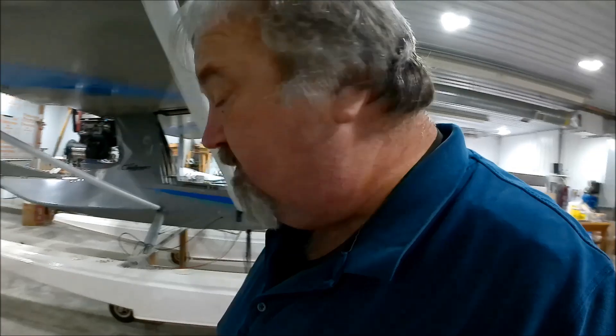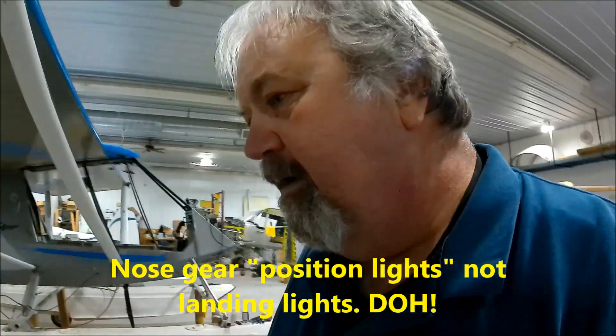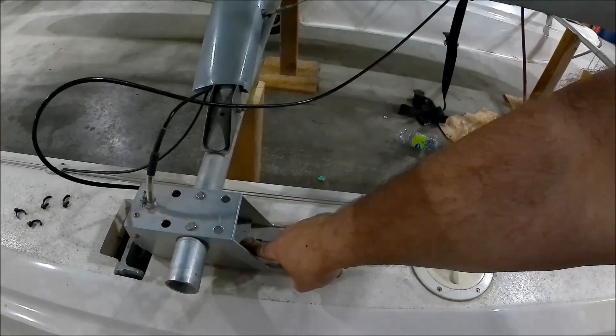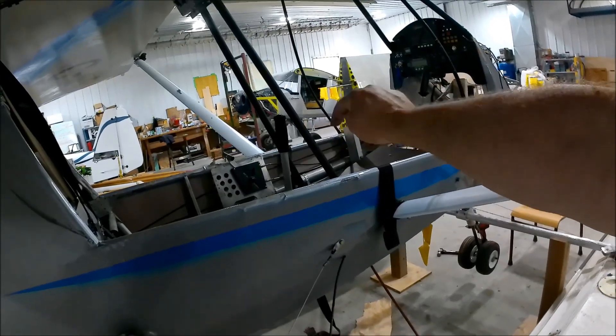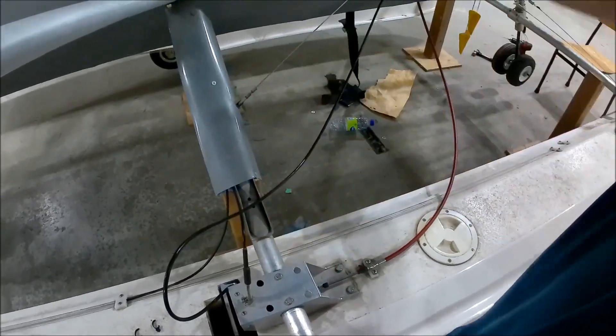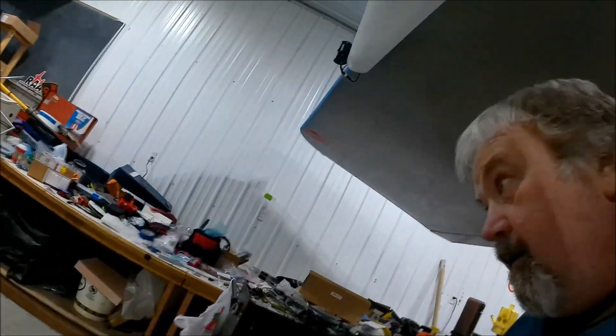The other thing I've done is the nose gear landing lights — that's controlled differently than the main landing gear. The main landing gear will have a lock sensor for these locks, and a sensor to see whether the landing gear is up or down. That's controlled by the little control box that's going to be tied in there, so that the unlock has to happen. And when the gear goes up and it's relocked, it sends the signal to turn the panel light green or blue, depending on what position it's in.